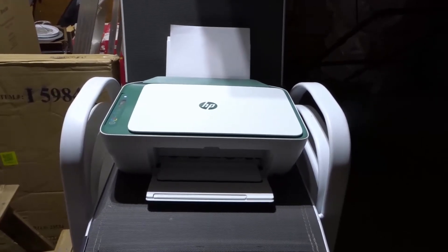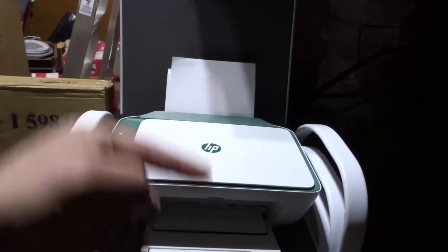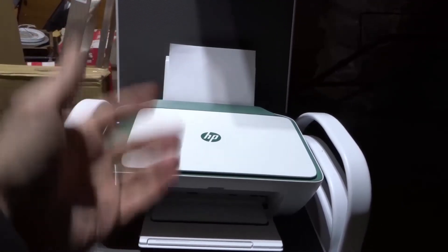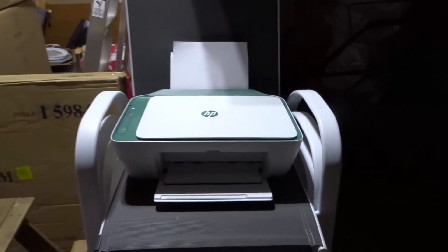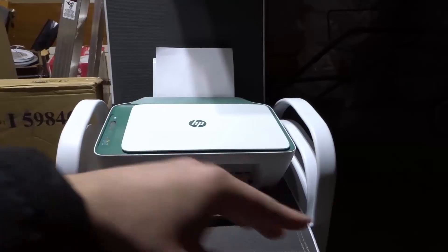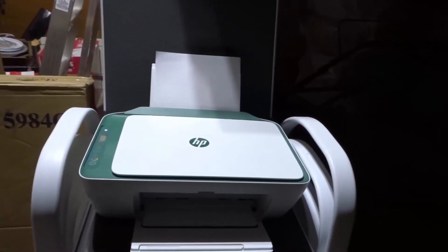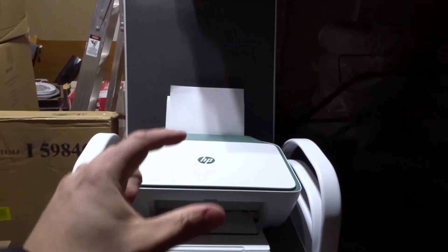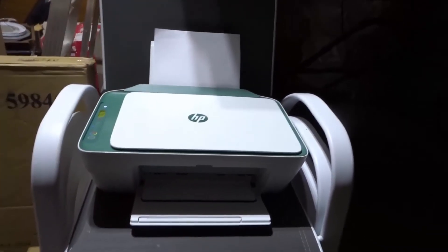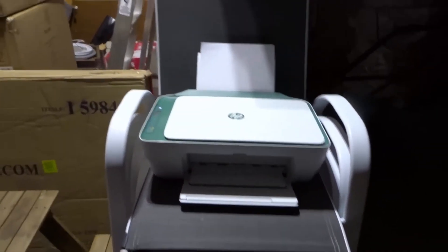Number four: is there a job stuck in the queue? Most printers won't print the next job until the previous one is either canceled or finished. If there's a job stuck in the queue — especially with multiple users on the same printer — your job might not be printing because someone else's previous job hasn't finished yet. Check the queue in your printer settings on your computer; if there's a job ahead of yours, that's likely what's preventing it from printing.